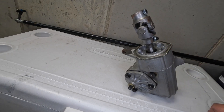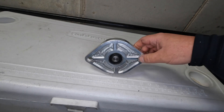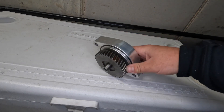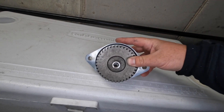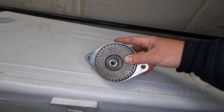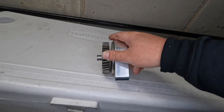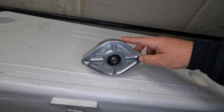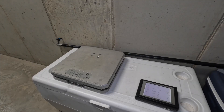This cool-looking billet piece is from NewPerformanceAuto.com — that's Steve Burton out of Virginia. This is basically a bolt-on block-off plate that still utilizes a factory Cummins gear with the hex cut into it for my fuel pump drive. Since I'm currently driving the fuel pump off the power steering pump, I still needed a gear there — I couldn't just do a simple block-off plate. This piece bolts right in place and still allows me to use a Cummins OEM gear to drive the fuel pump, getting away from any worries about that Chinese gear.